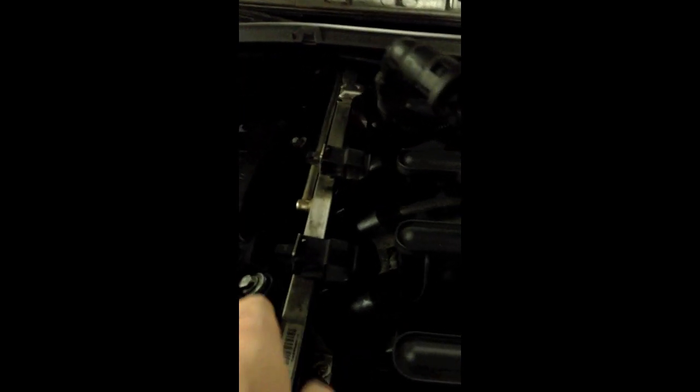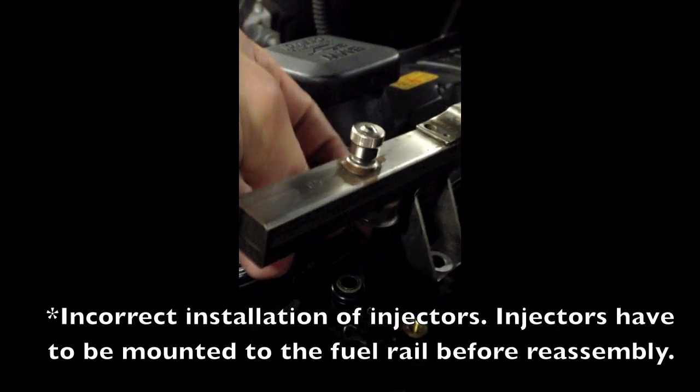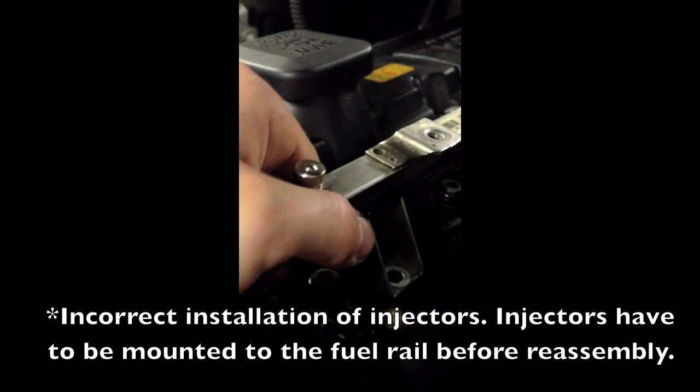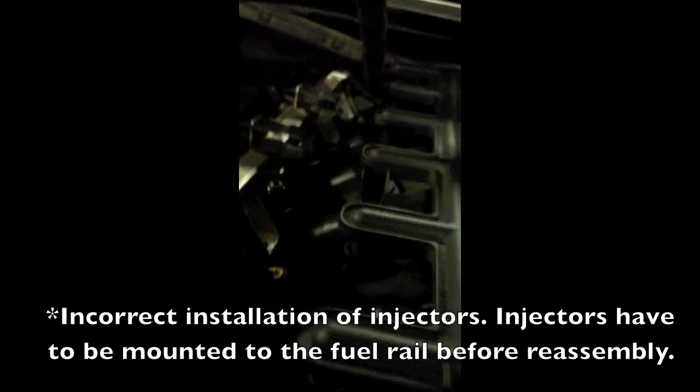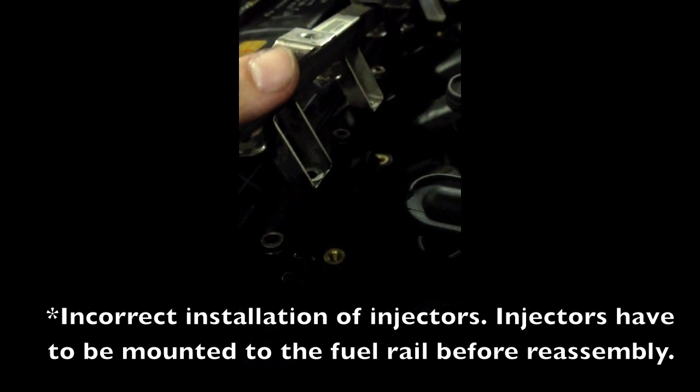I just disconnected the fuel rail from the fuel injector, so the fuel rail is floating free right now. After taking the clips off — these are the clips right here — they connect the top of the injector: it clips in there and clips into this thing right there. All these clips are out and I just pulled the rail straight up. There's a little bit of force — you've got to pull it. Then I pulled out each injector individually and they just come right out. They're literally held in there by the O-rings.